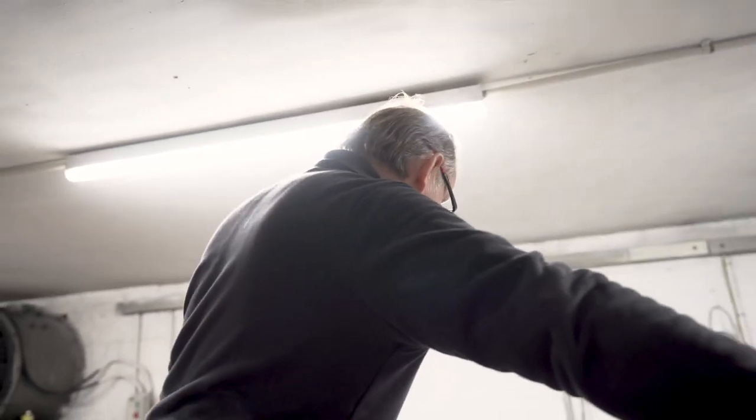Okay, so got another 4 or 5 minutes of reflash. Running too rich at the top end still, too lean at the bottom end. So we're making some changes. We're already at 210 brake at 10,500 RPM. So she's looking sweet. Spend another 3 or 4 hours just fine tuning and give it back to Tim to box it up ready for the customer.